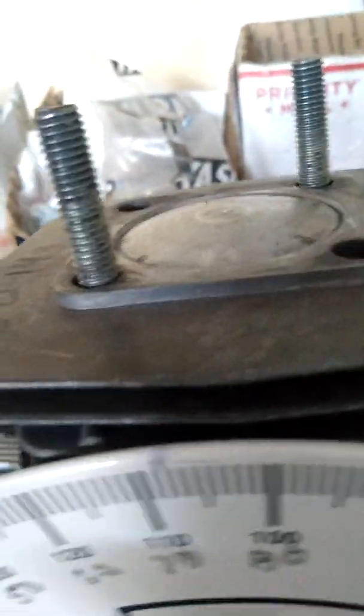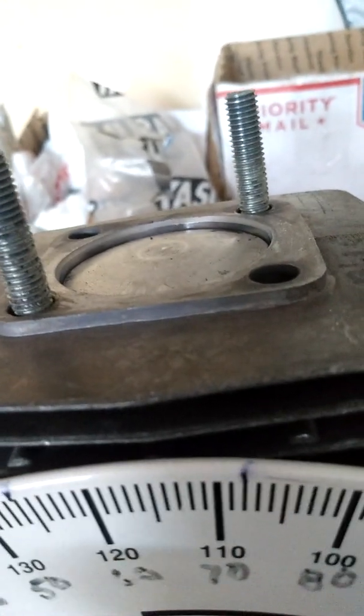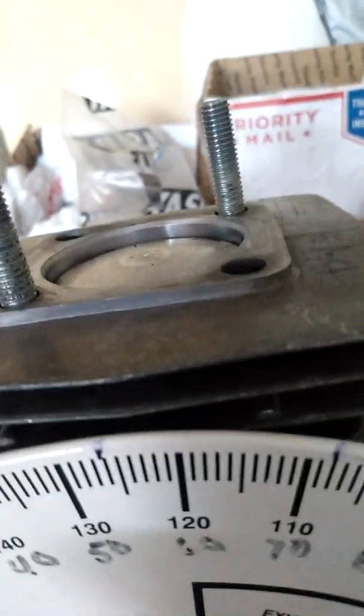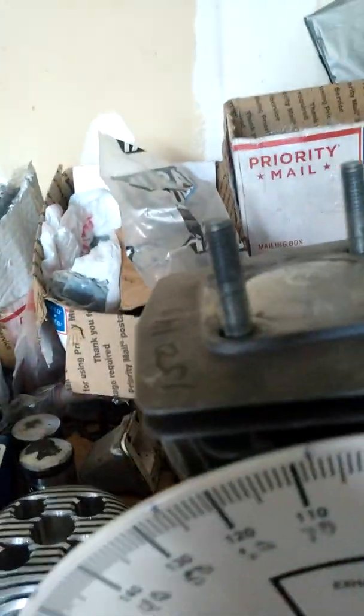As you can see, these cylinders all come out waxed. Not everybody has a machine shop or has the ability to machine a deck properly — I have an end mill I can use. I choose my port timings first. Transfers are low, at 110. If I stack two base gaskets, I have to put me at 120 on the transfers, and then consider a 0.7 millimeter head gasket.